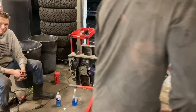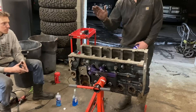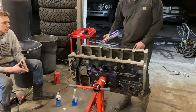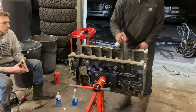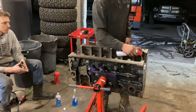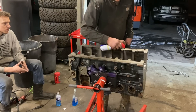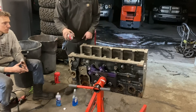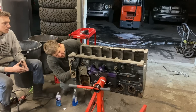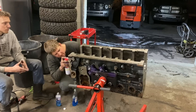Once you're done cleaning, we cleaned it with the bore brushes and the foam cannon, then sprayed it off with regular water, then blew it out. That brake cleaner spray helps disperse the water. Then all I do is good old-fashioned WD-40. The inside of the block doesn't matter too much, but I'll lube it well — mains, push rod holes. I skip the oil pan rail, hit the oil pump, and then do the cam tunnel with a flexi straw to get in there from both sides.